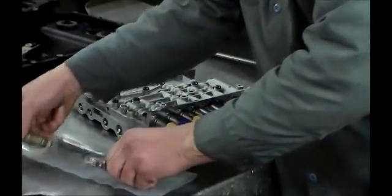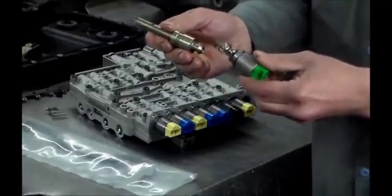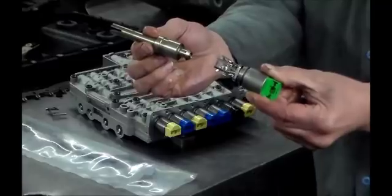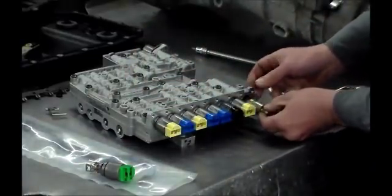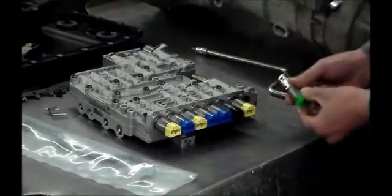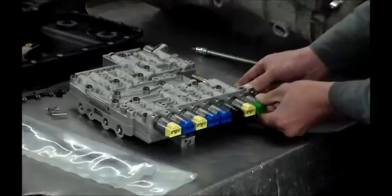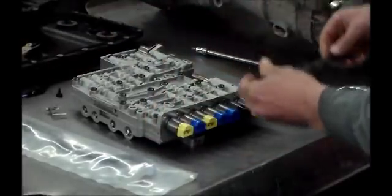The updated one you put in as two pieces. When the solenoid gets energized, it grabs it and retracts it. We're going to put the rod or piston in and then put the solenoid in — basically two separate pieces. Put that in, and just so nothing pulls out, let me put this back on with one bolt.